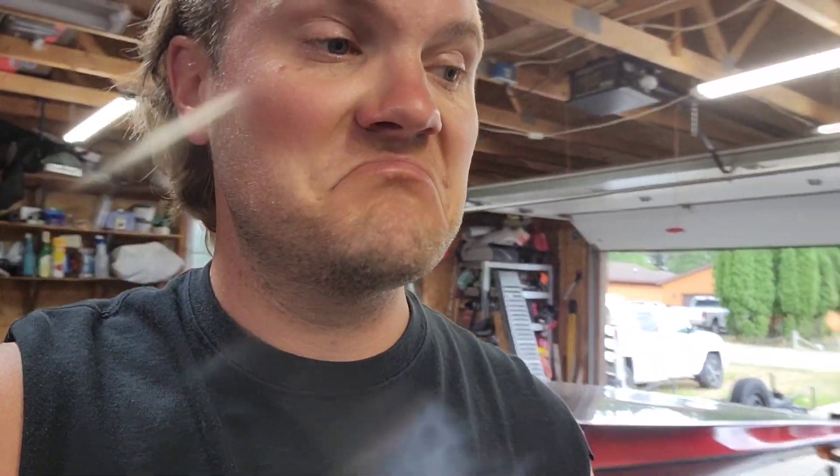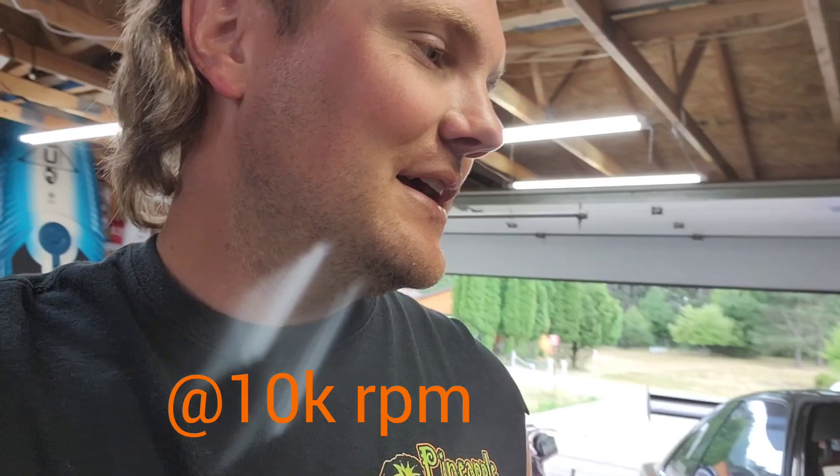Anyway, we put in the 4.9. I've run it the last four or five races and it is ridiculously stupid — I'm having to run around a bunch of the tracks in fifth gear because it tops out at just over 128 miles an hour. And when you're on the highway it's just screaming. So we found a guy that had a used 4.4 final drive setup, which comes with the ring gear and the shaft. We sourced that from a guy on Marketplace — super nice guy, thank you so much.